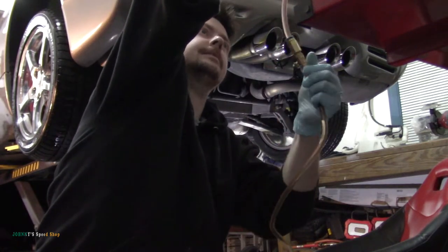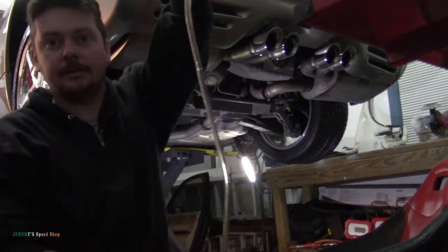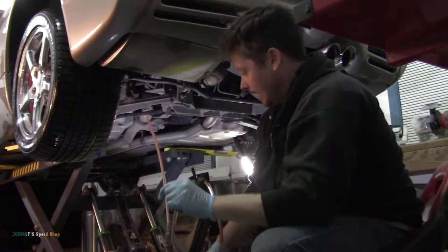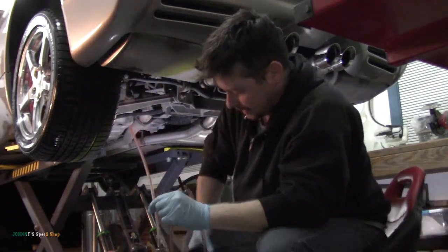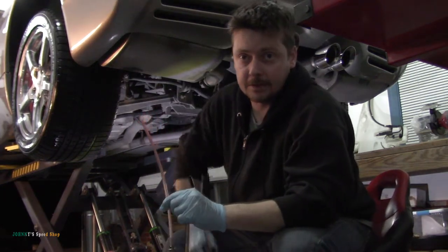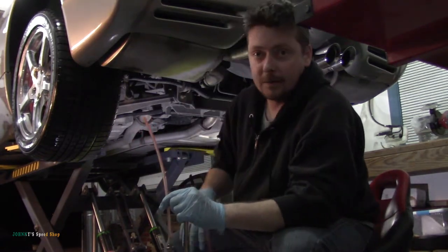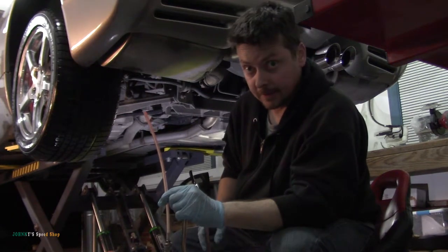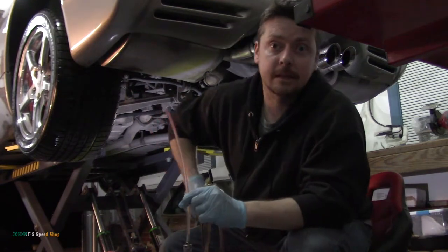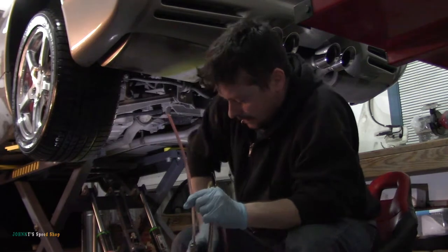We're right there. That's it. So we're getting gear oil at the tip. Ready to go. Same process as the transmission. We're just going to pop this up and fill it up until it runs out. I put a little bit of extra pressure when I'm doing gear oil because this stuff's so thick. I'm at about 18 psi. We'll go to 20. We'll try and get this thing to speed up a little. There you go. There's 20.